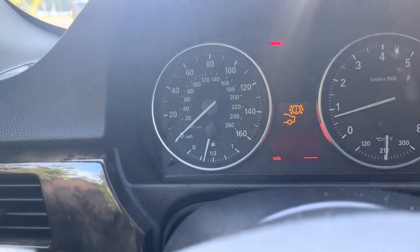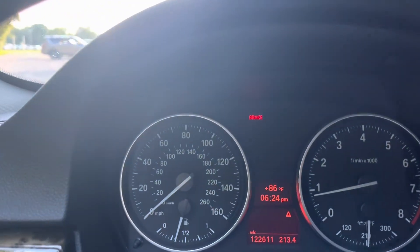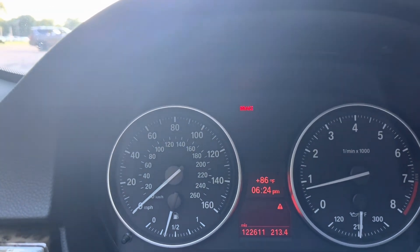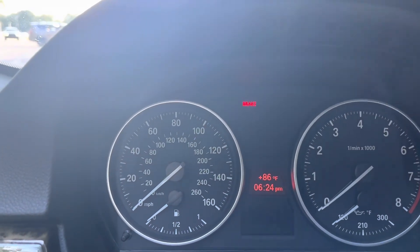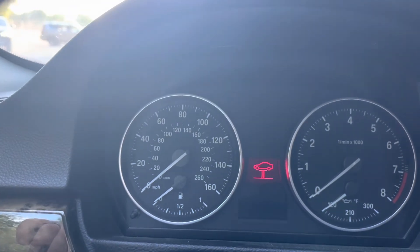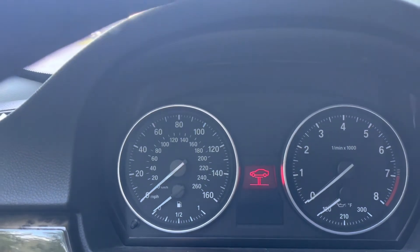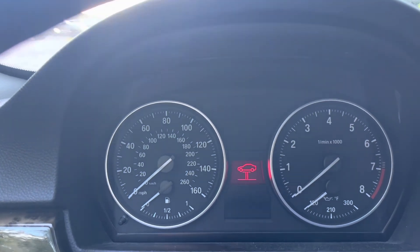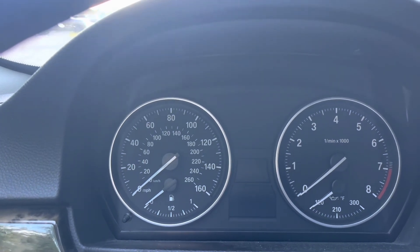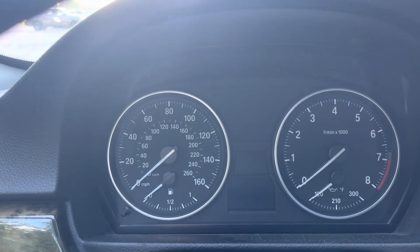What ends up happening is you're still going to have this triangle and a warning light, and you have this brake light that doesn't go away — even if I take off my parking brake, the brake light still stays on. When I turn the car off, I get that icon saying I need to get the car serviced because the car thinks there's something wrong with the brakes and it's a hazard. Long story short: if your brake pads need to be replaced anytime soon, don't go through the service icon reset procedure. Instead, wait to get your brake pads replaced and your brake sensors replaced, and that'll take care of it. Hope you liked this video — give it a thumbs up, stay tuned for more videos!